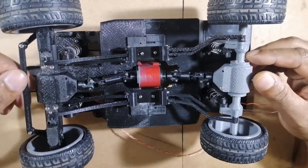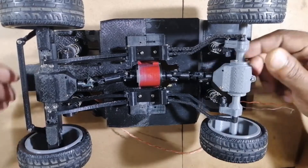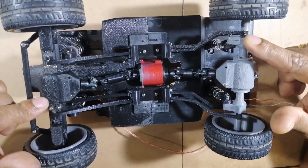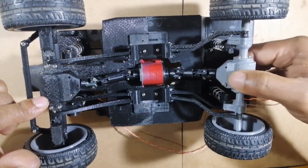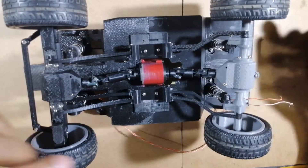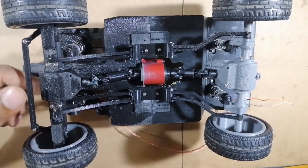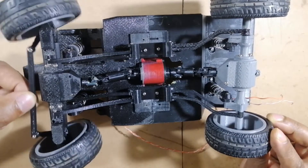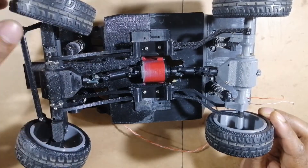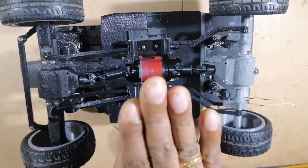Off-screen, I have made a few adjustments and calibrations to the assembly. I made a smooth angle of operation of the rear axle with the help of shorter lower stabilizer arms, which I shortened by 5 millimeters. That resulted in the rear axle mounting making a smooth angle with the drive shaft of the gearbox. In the front axle, I don't have the option to tilt the axle assembly because it is associated with the steering drive mechanism — tilting it would affect the smooth functioning of the steering mounting arms.